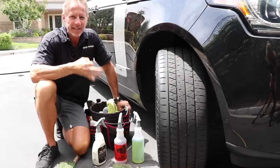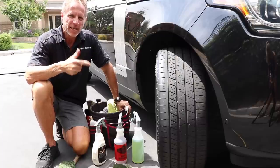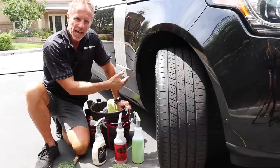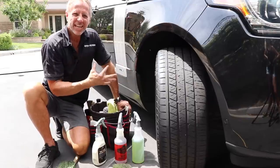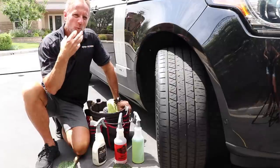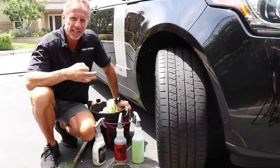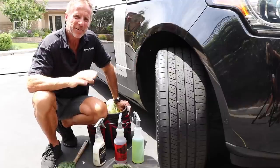Now, the more critical point: how do I deal with felt-lined wheel wells? There is no simple one-process-fits-all — it literally is a case-by-case situation. You need to pull back and gather all the specific nuances. Is it heavily saturated with dry loose debris, or is it saturated with thick mud from being driven in snow or rain? For the worst-case scenario — heavily soiled with dirt and mud — I would simply hose it out. If you have a pressure washer, that's your ticket. Hose it out to eliminate all the chunks, then spray some degreaser or all-purpose cleaner, and reassess.